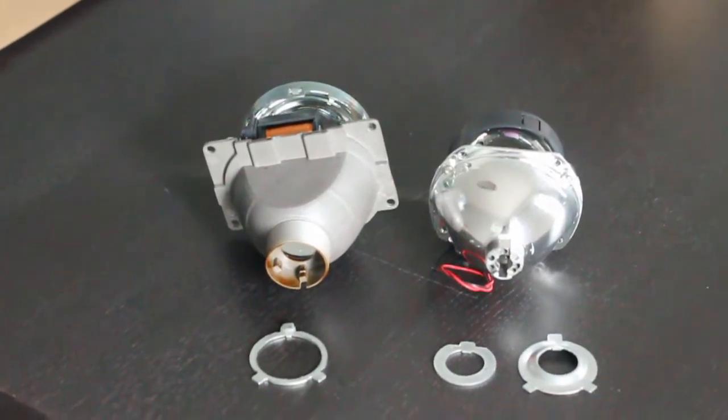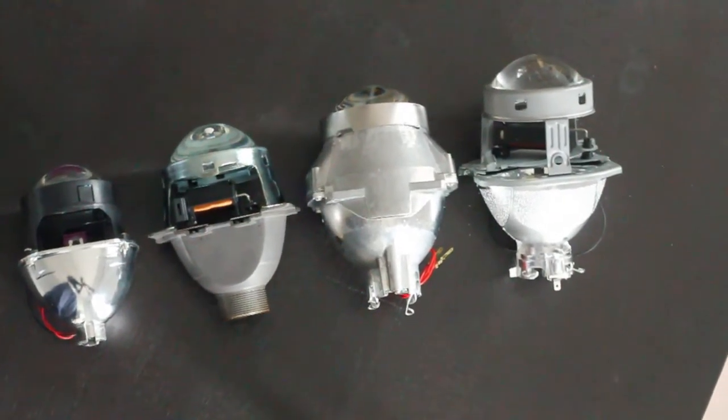To summarize when choosing your HID projector, consider these things. First, what's the OEM bulb type from your factory headlight? If it's an H4 or H7, our MH16.0 or MD2S 3.0 projectors will pretty much plug and play into your headlight. If you have any other bulb type like an H13, H1, 9006, or 9007, you will need to make modifications to the back of your reflector to secure down any projector — and that goes for OEM projectors from Lexus, Nissan, etc. as well. Secondly, consider the size of your headlight and the HID projector you're pairing it with. If you do decide to go with a smaller projector in a large housing, consider getting a larger shroud that goes around the HID projector so it fills the open space inside the headlight housing, making it look more complete and possibly OEM.